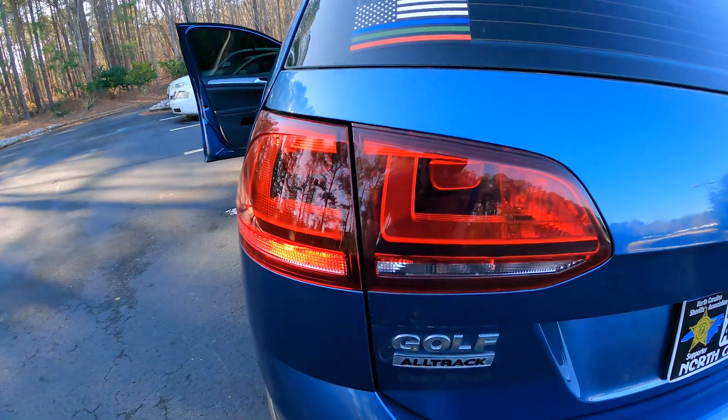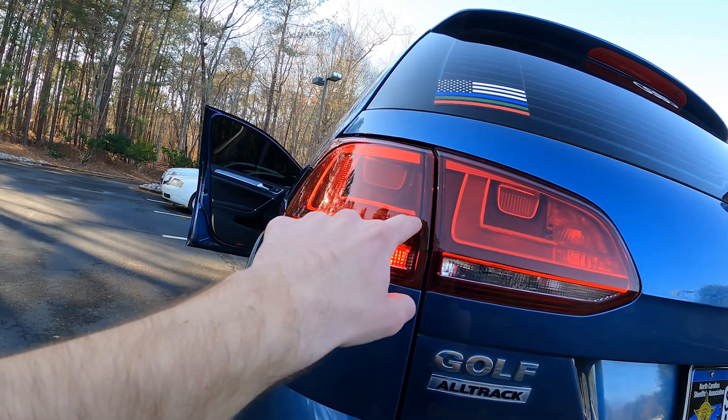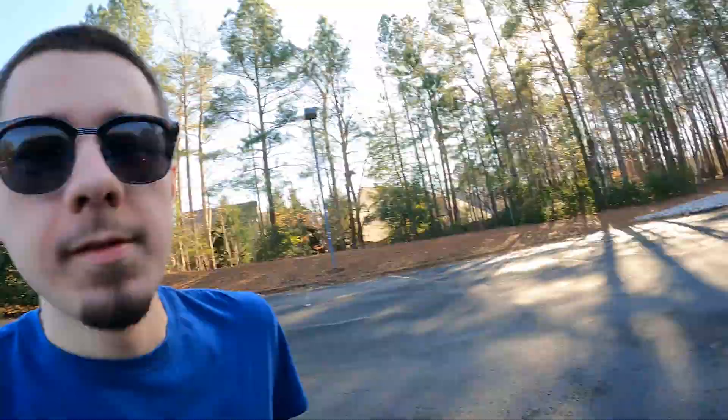This is not the only thing you can do with your taillights. There's also a way to make the inner pieces light up with the outer pieces as brake lights, so both sections light up together. There's also a way to make them flash back and forth as turn signals, but I think that looks kind of stupid — it makes the back of your car look like a railroad crossing. Also worth noting: my fog lights, taillights, brake lights, turn signals, and reverse lights are all LED, which in the US is not factory, but no coding is required to swap the bulbs out.